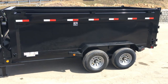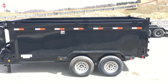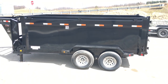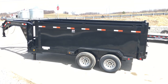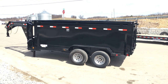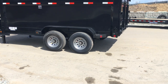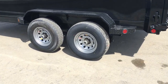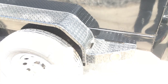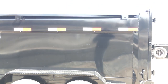From the side shot, Iron Bull does a little bit heavier trailer overall than some of our other manufacturers. They use a 10-gauge sidewall and floor. You'll notice toward the top of the sidewall they do an integrated keyway or body stiffener that gives it a lot of additional strength. They also use a double broke tread plate fender with the fender gussets — gives a lot of support, a little bit stronger than the single broke fenders. The side step kind of comes in handy on a high side like this.